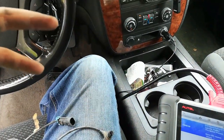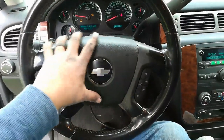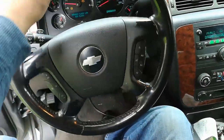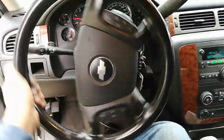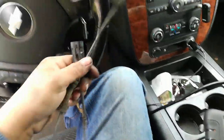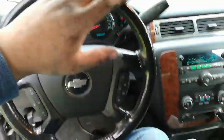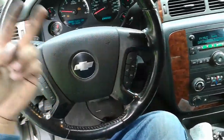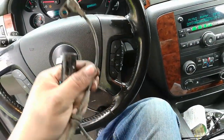And it'll just help compensate the ABS and the stability control. Also there's a yaw sensor and a steering angle sensor that detect if you're losing control, like your steering wheel's this way but you're going one direction. Basically, one of these going out can disable the entire ABS system, the stability control, all kinds of stuff, just because you have one stupid sensor that went out.